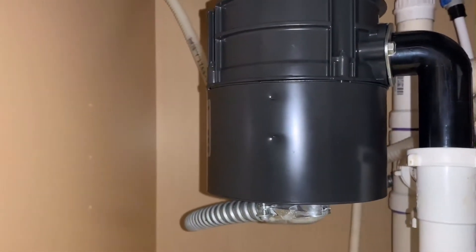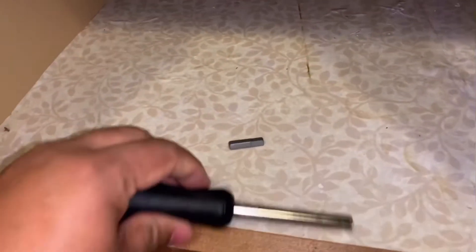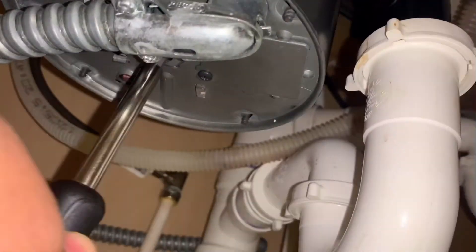So the next thing we did is something everyone should know. This is the food waste disposer — it's right inside your under-sink cabinet. You'll see that right at the bottom there is a slot. All you need is a screwdriver with an attachment that fits into that slot.